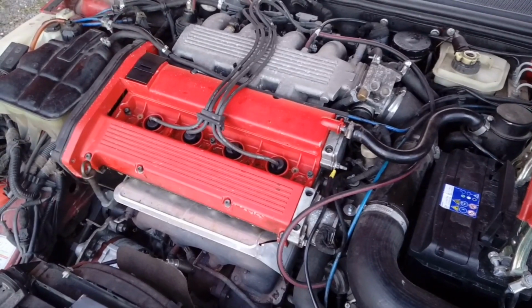So I will check now for water in the oil. Some of you made a comment about the belt adjuster, the belt tightener, who makes sure everything is tight enough. That one could be faulty. Or I have a problem with the timing belt. That could also be a problem, and that is making the metallic sounds because the valves and everything are not going in exactly the correct sequence. But let's try now water and timing belt, and there was one more thing. I will remember when I get out.